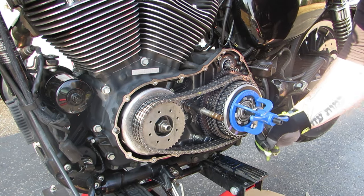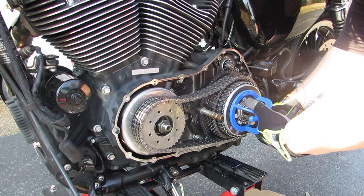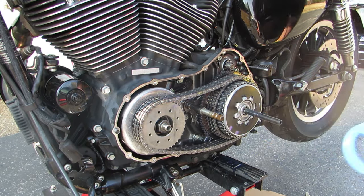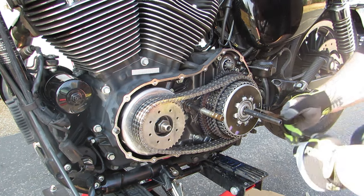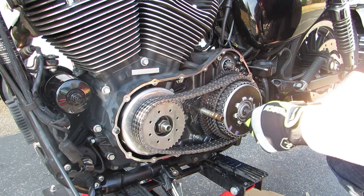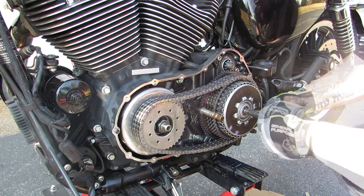Once we have the ring in place, we come back in with our wrench once more, and we can loosen the handle on the compression tool. With the handle out of the way, we can then take off the compression cage itself. Then I like to grab needle nose again here to provide just a little bit of pressure against that bearing in order to help me get the piece off of the adjustment stud.